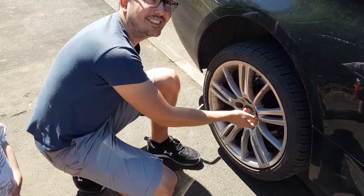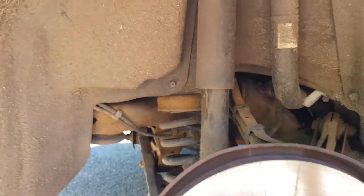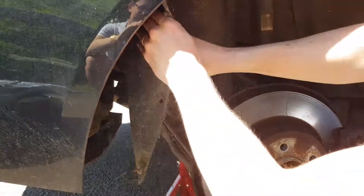The speed sensor is located behind the brake disc. To get to the sensor connector you'll need to remove the rear part of the wheel well walling. Thankfully you don't need to remove the whole thing. The bolts for this can be found here. The material for this walling is fairly malleable but you'll need some jiggling around to allow for the access you need.